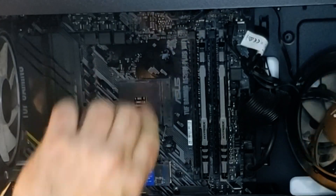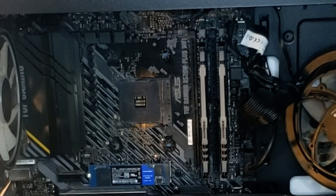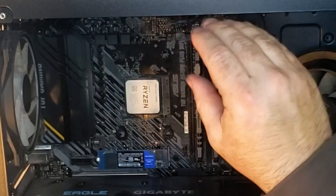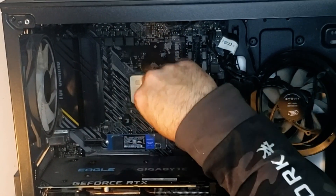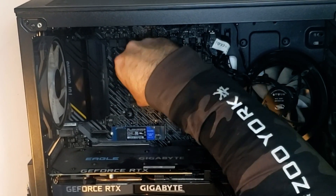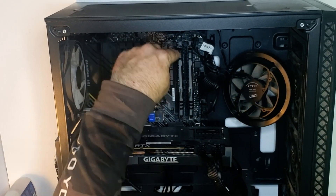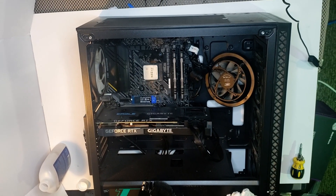You look at that marking, and then you look at the underside of your processor and you see an alignment. That aligns the chips onto the board. It drops right in if you align it perfectly. Most people bend it because they don't actually look at that — they don't align it. But most computer chips always have an alignment mark on the board. Even the soldered-on ones usually have an alignment mark.